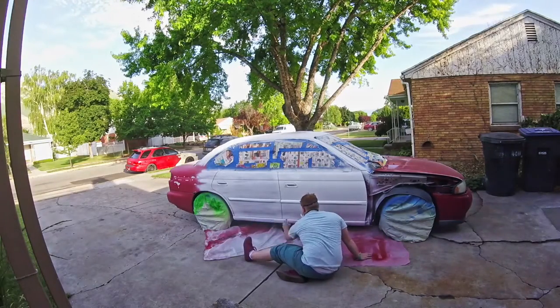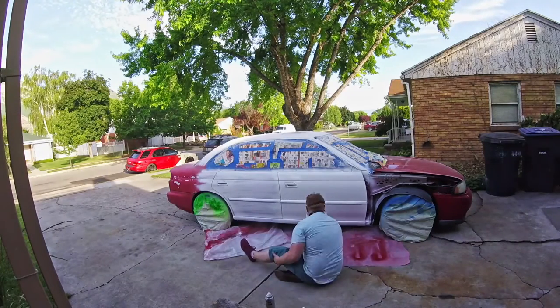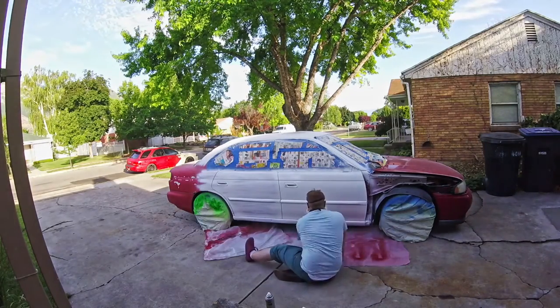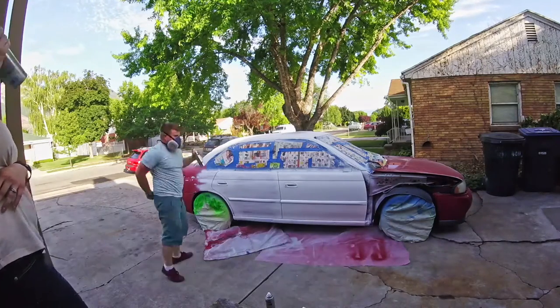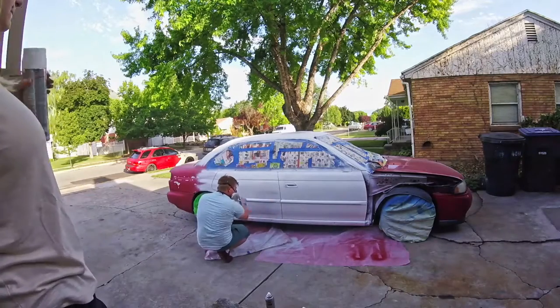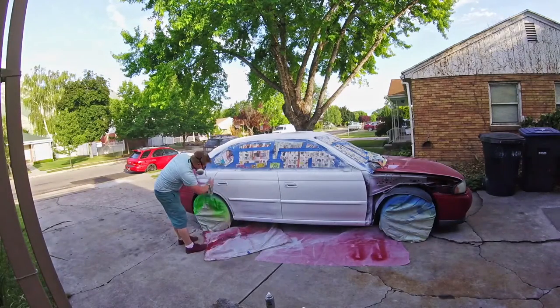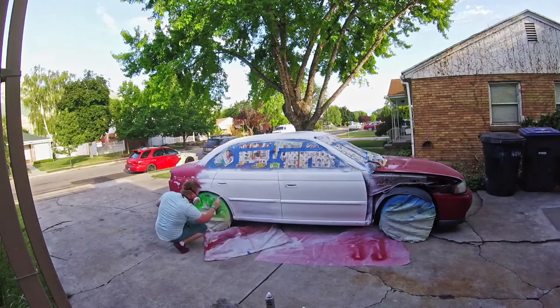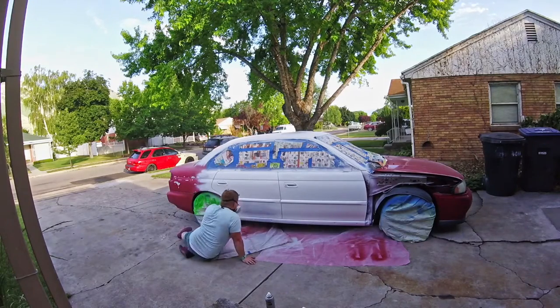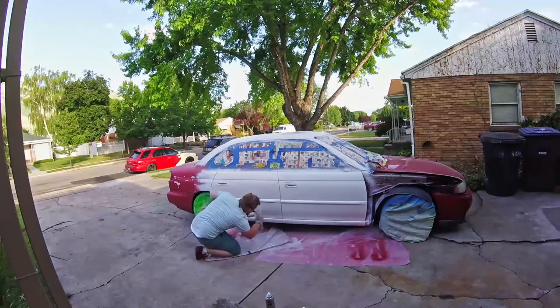Once the car has a light coat on, you're ready to do a full color coat. As you spray, be very consistent and overlap on each pass. Make sure you have enough light so you can see how the paint is laying down and bonding with the last pass. To have a consistent sheen, you want to create a line of wet paint that moves across the panel as you spray — the tail end will start to flash, but as long as you keep the wet line consistent you'll end up with a great sheen.